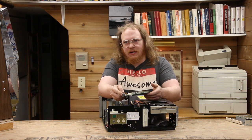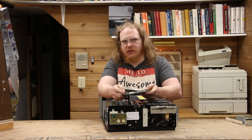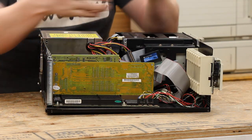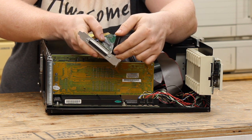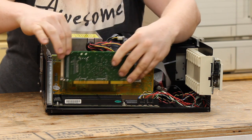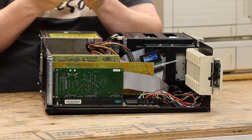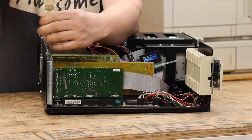That doesn't sound like a whole heck of a lot, but that's pretty fast for tape in such a format. Think about it — in 1993, how big were your files? That's more than enough to burst a couple of files to tape at one go with compression. So what I'm going to do here is pin one to pin one — attach our ribbon cable — and then drop that into the slot right here. Then I'm going to take a single screw and drop that in to hold it in place.